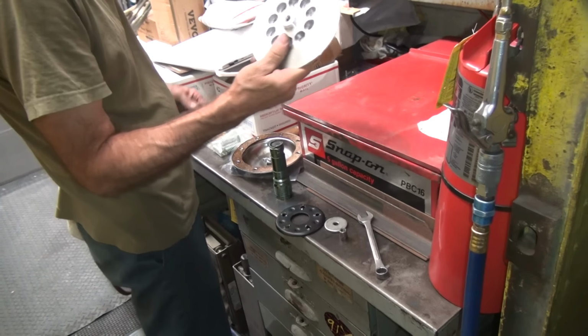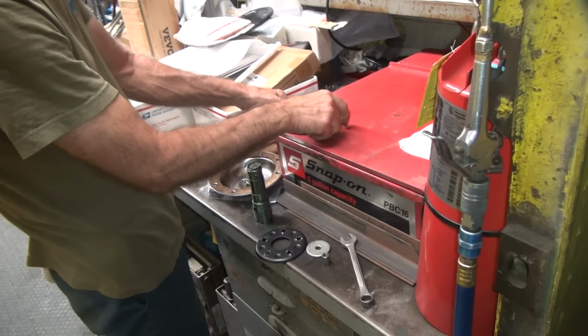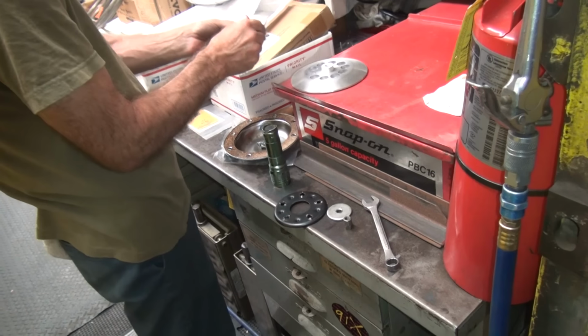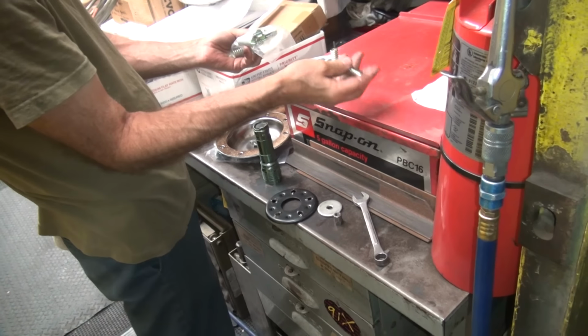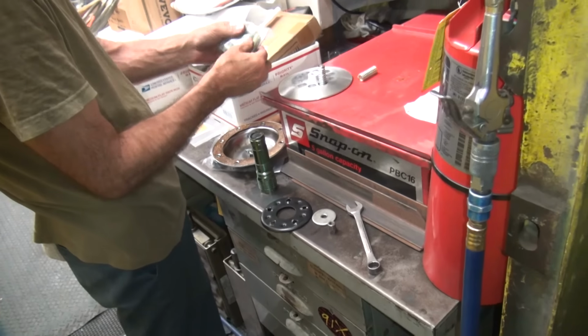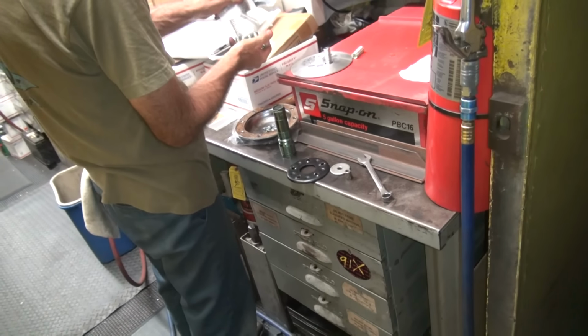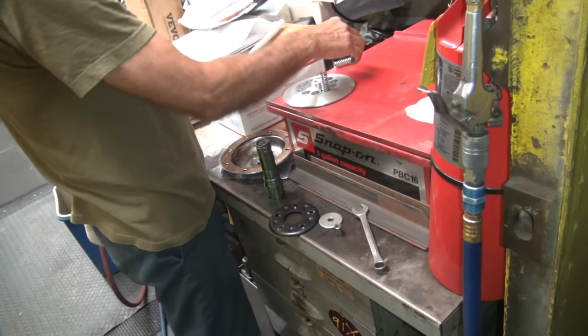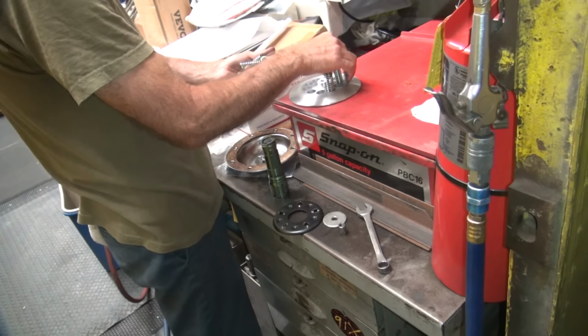Okay, we're going to try an aluminum pressure plate, which eliminates a lot of flex. You said the springs are a lot better than what you've got over there. These are hand clutch springs, which are real tall and stiff. Pretty short patterns. At least you don't have a big problem with super uneven spring tension.